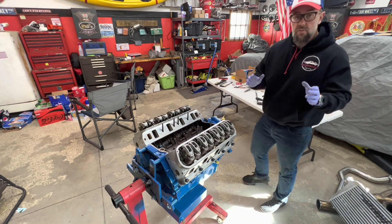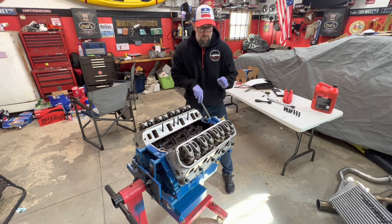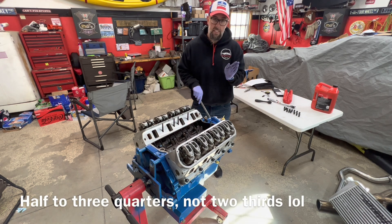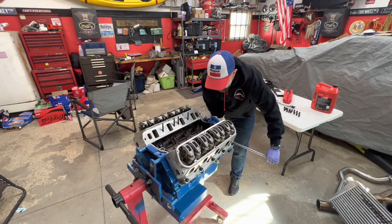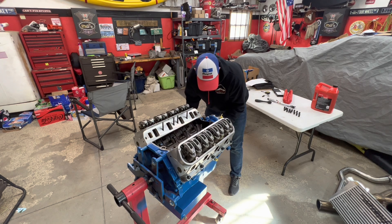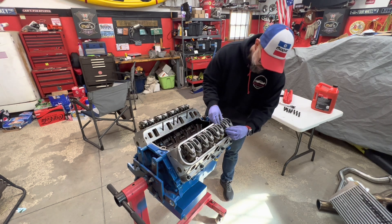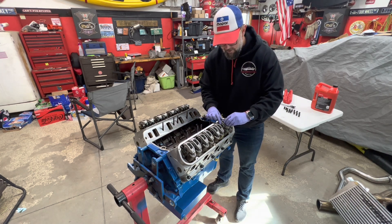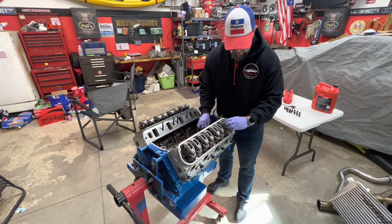The exhaust valve is a little different. For the exhaust, you're going to be looking at the intake push rod — you want to watch it go all the way up and then come down between half and two-thirds of the way down, then stop. So right now the exhaust is going up and back down; the intake's about to come up. We let that go all the way up and get about halfway down. Now we know the exhaust is on the base circle, and we repeat the exact same procedure — make sure it's straight, push rod's good on both sides, take out the lash, half turn. Then do it 15 more times.